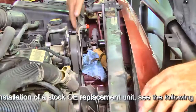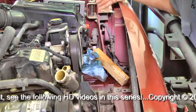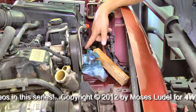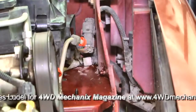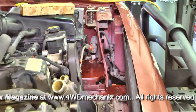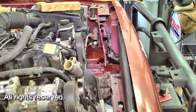The radiator should now be free. Both lines are out of the way and this hose is loose. Lift the radiator up carefully and out of the engine bay — and that's the radiator removal. We'll cap off this transmission cooler line to make sure we don't get any contaminants into the AW4 transmission. Then we're going to remove the belt, the water pump, and the fan and fan clutch. Transmission lines are both capped now, the radiator is out, the air conditioning condenser is still in place, lines not disturbed, and we won't have to recharge the AC system. If this was just a radiator replacement, we could stop at this point, but we're going to do the water pump and also change the drive belt.